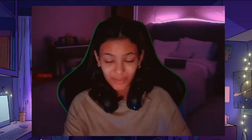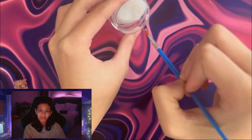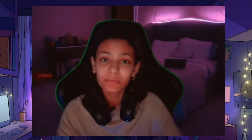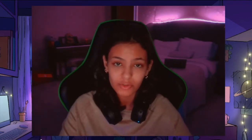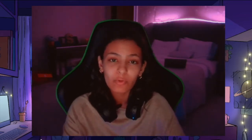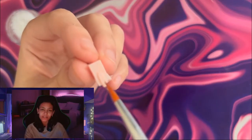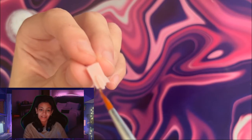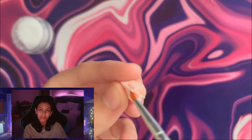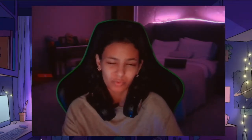Next, the stem. For the stem, you're going to need a paintbrush. All you have to do is carefully brush all sides of the stem with lube. Make sure you can't see any white residue — you're using too much if you do. The look you're going for is for the stem to look a bit shiny. You need to apply lube to three areas on the stem: the rails, contact area, and the legs. I only recommend lubing the legs if you're doing linear switches; if you're doing tactile, you don't really need to do that.